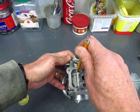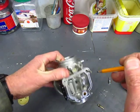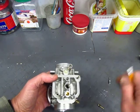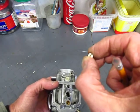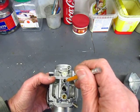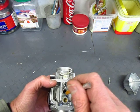The other edge of the fuel well has a passage that runs all the way to the airbox side of the carburetor. This is higher pressure air; this is lower pressure air. So we can pull air through this passage and into the bottom of this well. It will create enough vacuum to pull fuel into the well through this jet and out through the little air tube holes here. So it's able to suck fuel out of the float bowl when the engine's running at idle, because we can get a much lower pressure down in this well than in the main jet well.